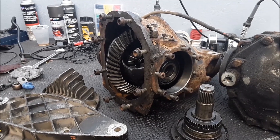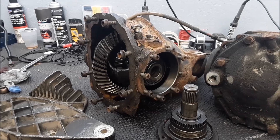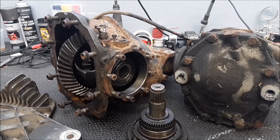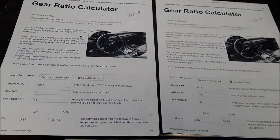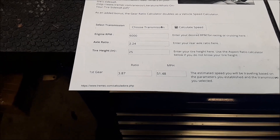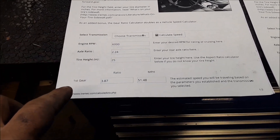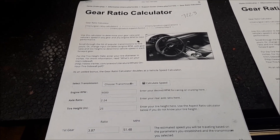I really doubt you're going to have too many issues. I think that rear differential — the 3.69 gear in that car — I wouldn't do anything else to a 400E without putting a good gear in it. If you have an ASR car, it's just not that simple because you're going to have limp mode and a bunch of other issues. But if I had a non-ASR 400E, I do believe they made those — I wouldn't waste any time. I'd just get a rear differential with the 3.69 from an early 300SL. Tremec's got a really nice calculator online and you can see the difference that that gearing is going to make. I took a standard 400E standard tire size and used a TDM manual to look up the gear ratios. It's going to give you where this transmission is going to shift. If you're shifting at redline, you're going to do almost 52 miles an hour in first gear. A good way to explain it is like trying to ride a 10-speed bike in 10th gear.